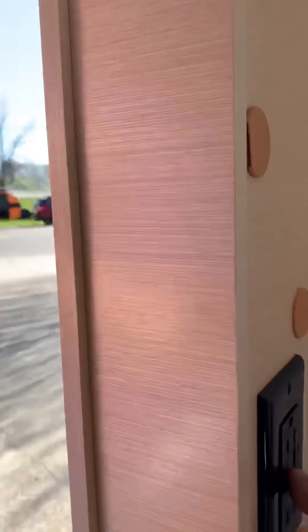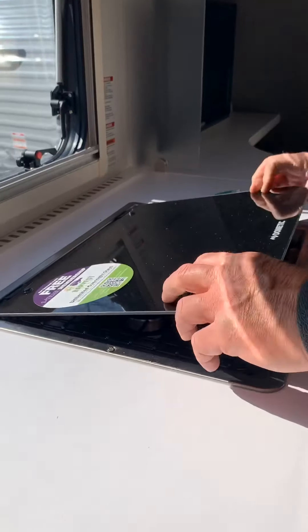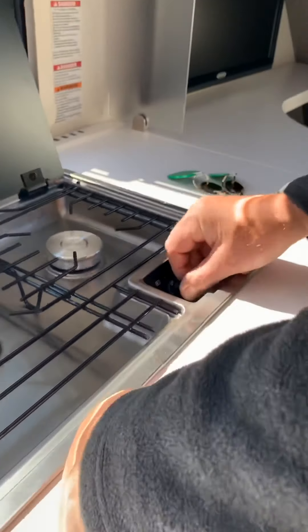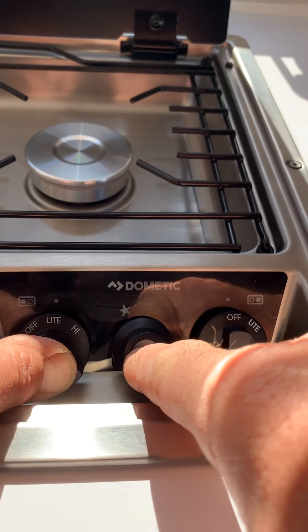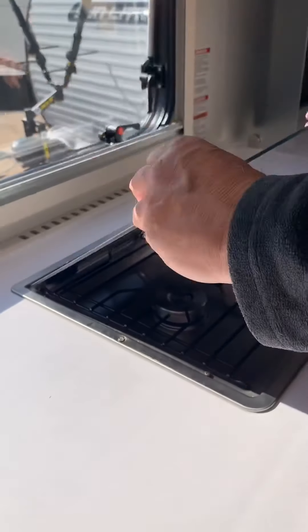Here's a 110 outlet — that's where your ground fault reset is. This is our stove. Now you notice this won't come down — you have to lift it up to bring it down because it locks in place so it doesn't fall back on you. But you also have to lift it up and unlock it to bring it forward. To light the stove burner, you turn this to the light position and push that in. Then you push the little lighter down in the center and that'll light your burner. Once it's going for 30 seconds, you let it out and you can turn it to whatever setting you like. Don't just pull it down — lift it up and it drops down.